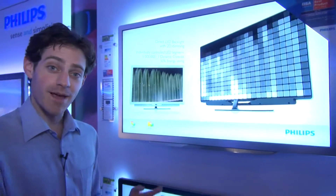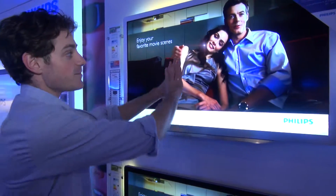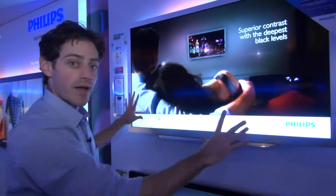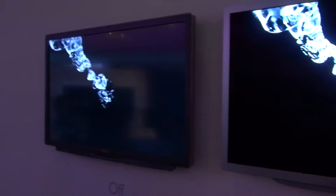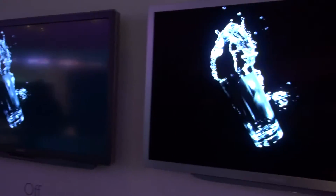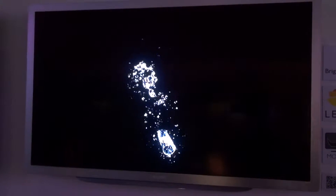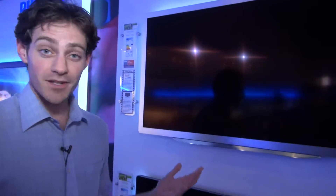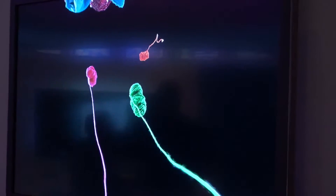The kind of blacks you'd normally expect of plasma TVs rather than LED TVs. The LED backlighting goes across the entire panel with 224 differently controlled zones, and this allows the TV to be much more sensitive in contrasting between the dark and light areas of the picture. What we've learned looking at this model is that moth eye, if it works, seems to be doing something pretty damn good — frankly we're not seeing the kind of reflections on this screen that we are on others.